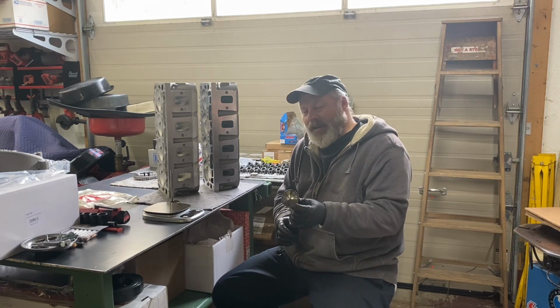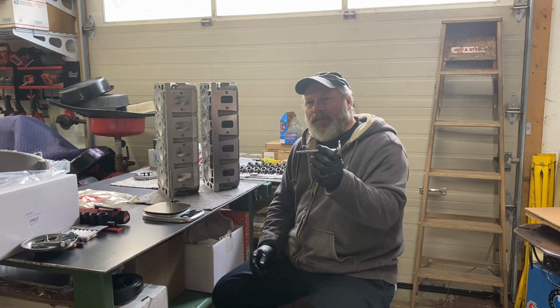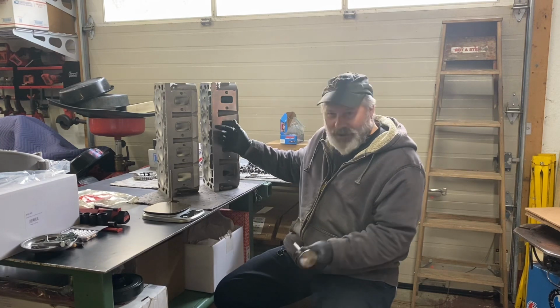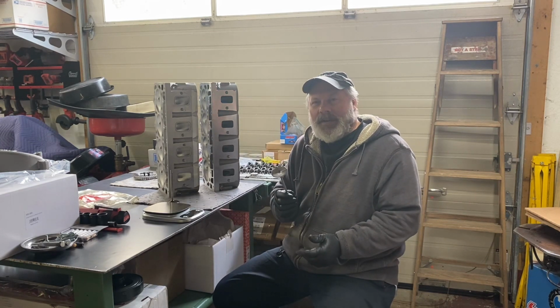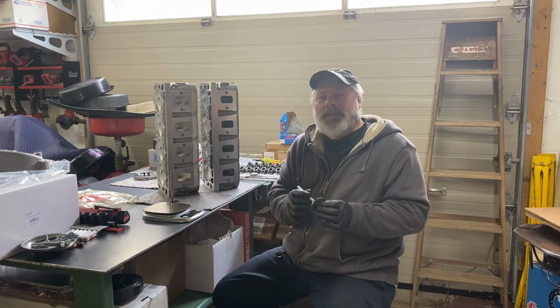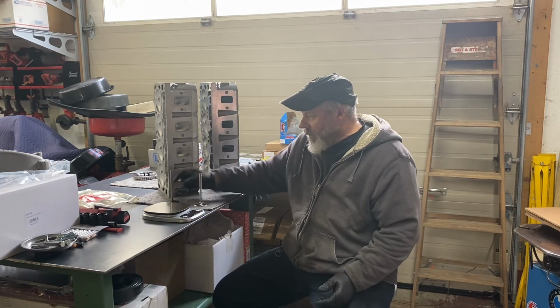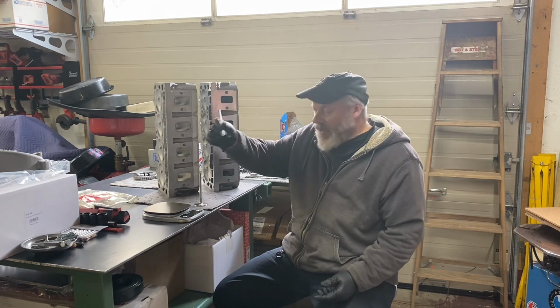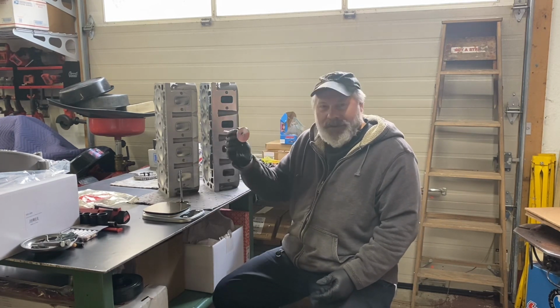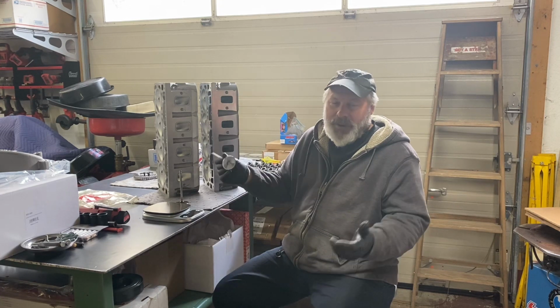So I bought some 5.200 intake valves for the Chinese head, and I have some 5.200 long exhaust valves coming, but in stainless. And so what's the difference? Again, this valve is 250 thousandths longer. It's still 41 grams lighter than the stainless valve. That's pretty significant.